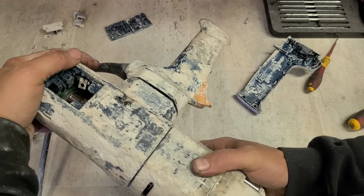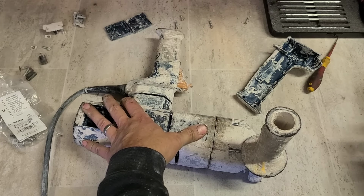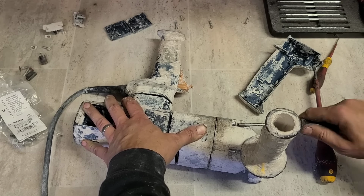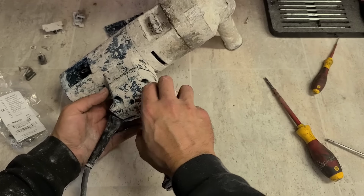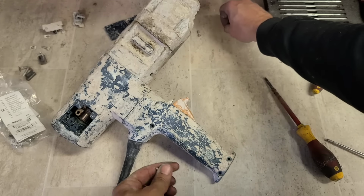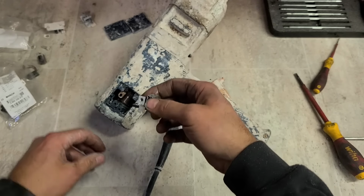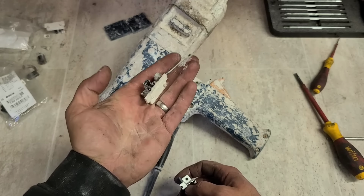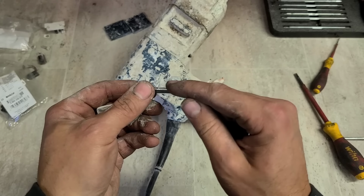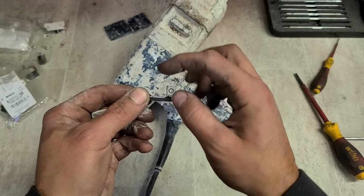They only go on in one direction. These holes only line up one way. The actual problem, brush holders. Now these are different from the older ones. These old ones are obsolete, can't get them anymore. You have to go with these newer type ones now. A little bit better, instead of a square box, they've got flat edges, only a few flat edges. The corners are all elongated, rounded and widened out.